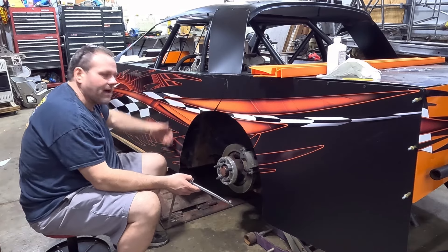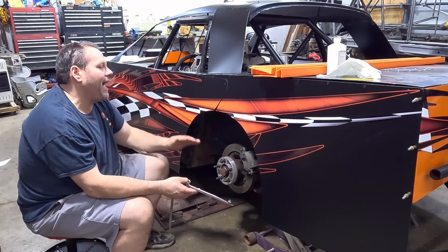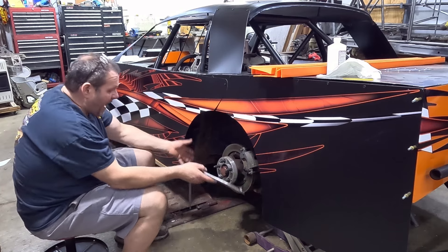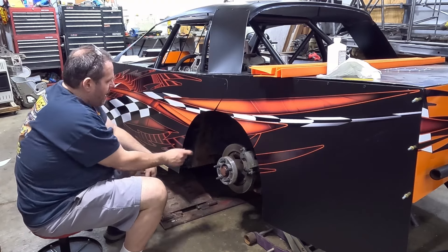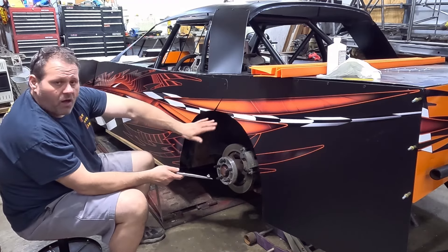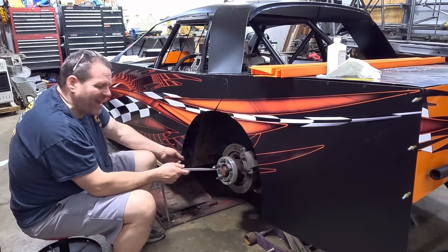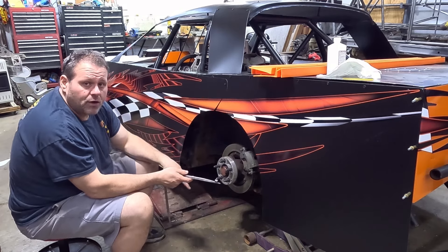Don't worry about the rest of it - it makes it a lot easier to get this side off anyway. But I have to make sure that I clear the tire through its movement to not hit. What I did was I had the tire on here with the car sitting at ride height, and I just took and followed the tire all the way around about an inch and a half out all the way around to create clearance. That's with the lead and the trail and the rear end set up correctly, so I'm in the right position front to back. I just took my clippers and ran all the way around it about an inch and a half. This is about 31 inches across here.